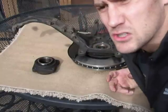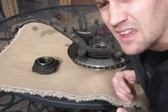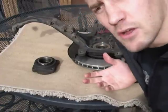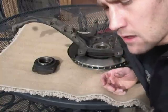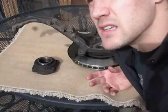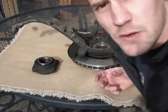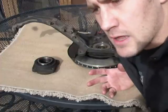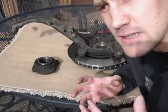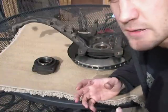Hi, I'm Brad Grissom. I'm going to show you what I learned in replacing the brake rotors on a 1995 Honda Accord. I had a lot of questions when I started, and I really didn't know how this all fit together, so I've learned a lot and I'd like to share that. This should apply to all fifth generation Honda Accords, which is 1994 through 1997. This is a trapped rotor type configuration, which I didn't know about before I started this project. It means that the rotor is trapped between the hub and the knuckle, and it's not easy to replace your brake rotors like I was hoping it would be.